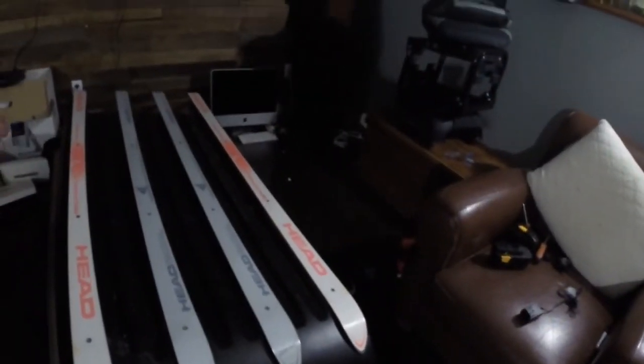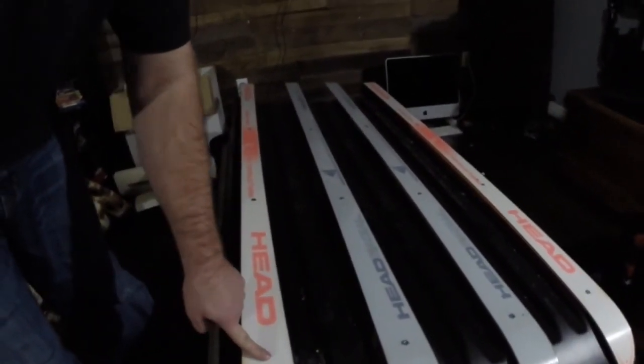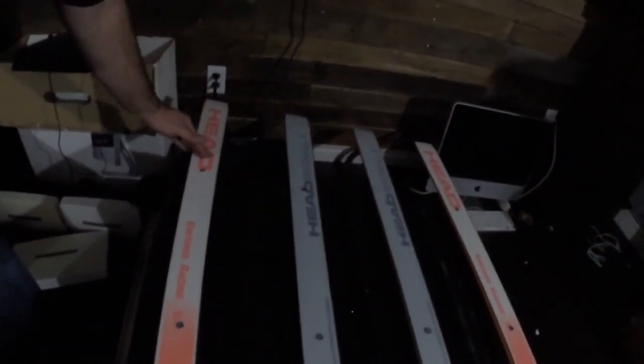Alright, so that's the gist of it — I've got this one in. Tomorrow I'm actually going to go in and fill the holes from the inside of the hut with silicone, in case I get into some slush and don't want water leaking in. So before I actually tighten these up — right now they're just hand tightened — I'll go back in, fill them with silicone, re-tighten them, and then add some Loctite to the bolt so it doesn't shake loose on the rides. This is going to keep the sled off the ground and should keep it running straight as well. I still haven't decided if I'm going to keep the extra bit at the end or cut it off — I'll take it out for a test run and if I like it I'll keep it, if not I'll just hack that back bit off.